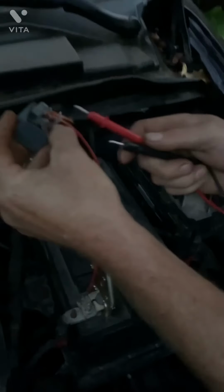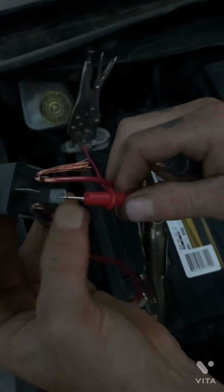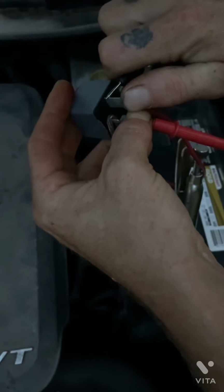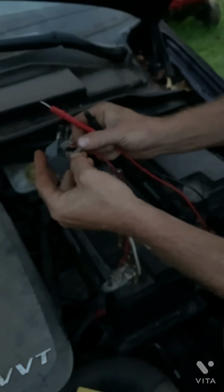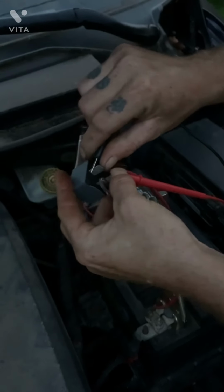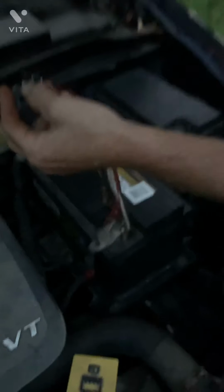Now we'll hold that up. We'll put one lead here. The meter's still on continuity. So we're definitely getting juice through this circuit. If you hear that beep with it hooked up to power, see, hear the switch. You want to make sure that that switch engages. If the switch isn't engaged, you get nothing. So you make sure. And that's how you can tell if your relay's good.